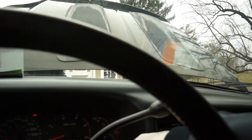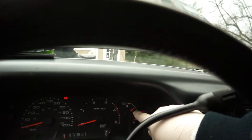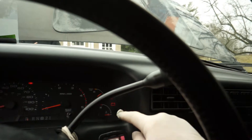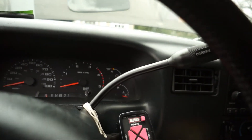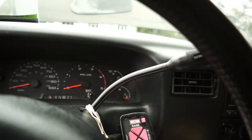It raises a little bit, so we know we've got continuity going out to the temp sensor. But you can see the transmission sensor is halfway — this main temp for the engine should be at half as well. We just drove this truck and you can see it moving, but it's just not reaching up to its half peak like it should. So we're going to go ahead and swap it out.